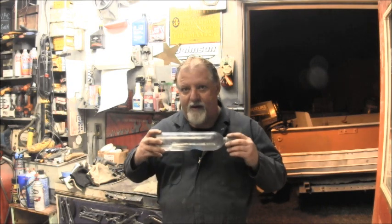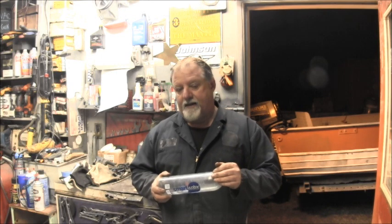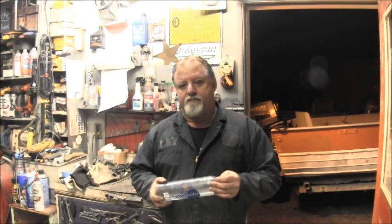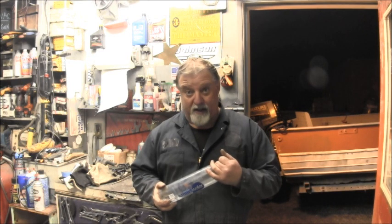The power head sounded good. So that drags me a little deeper into the rabbit hole. Hey, this power head sounds good without that lower unit on. Well, I don't have the carburetor, the electronics, anything on this engine. I chopped the water tube, changed out the shift shaft to short. Had quite a bit of a pickle of that thing going up in there, into the power head. So I'm a little puzzled on this one.